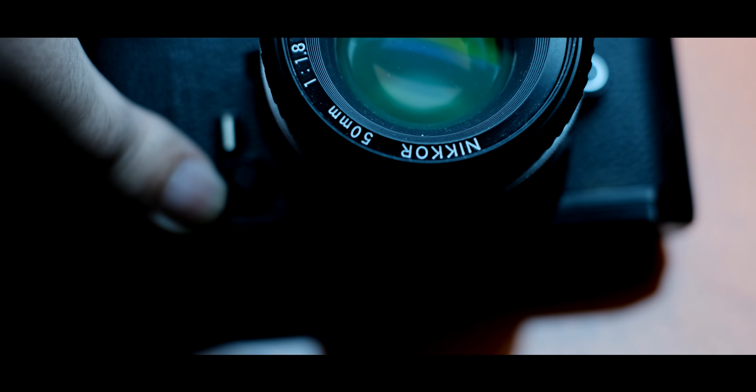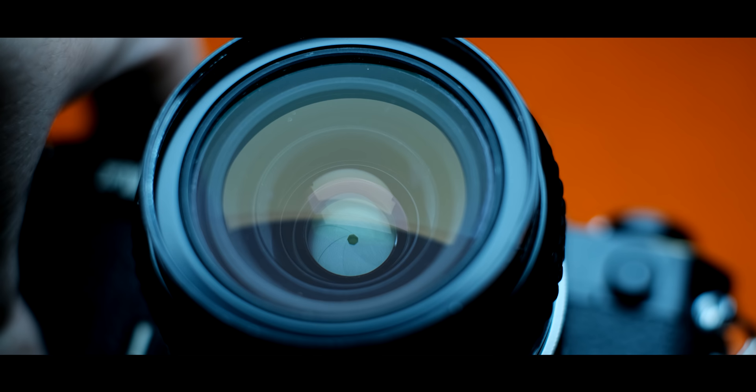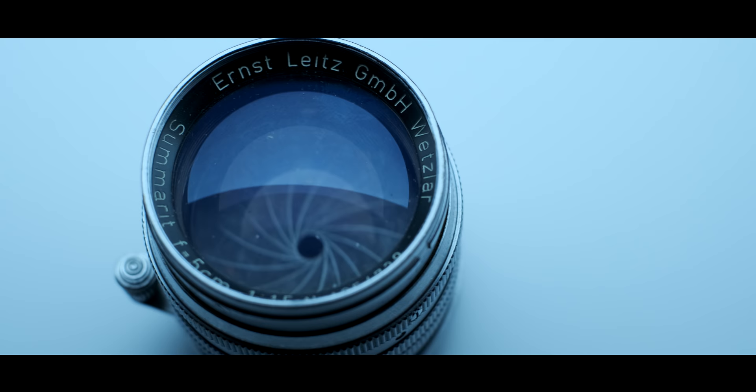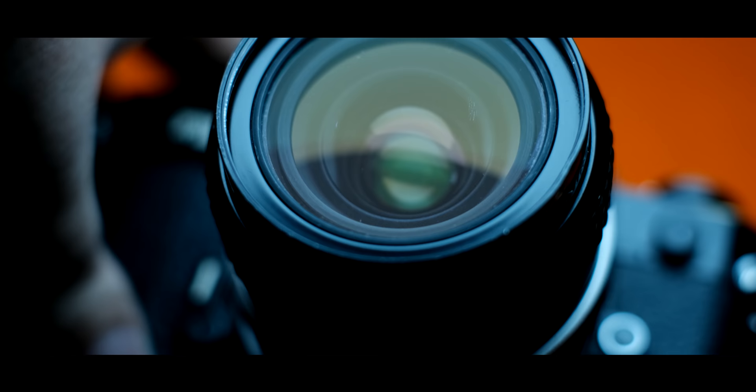Another thing to check for is oil on the aperture blades. This is a bigger issue if your lens is for an SLR. When you fire the shutter with your lens stopped down, the aperture blade quickly closes and then opens back up. If there's oil on the blades, they may stick and not close down when you want them to, or they'll close and then won't open back up again, making it hard to look through your viewfinder. This is fixable — take the blades apart, soak them in alcohol, and reassemble. Oil on aperture blades is less of an issue with rangefinder lenses because those don't actually close during the exposure; they just open and close manually.